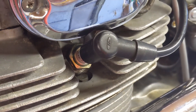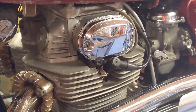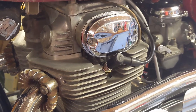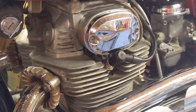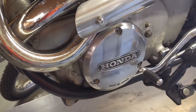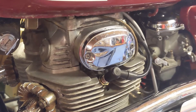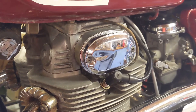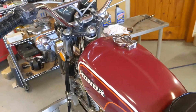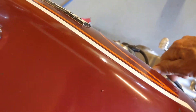Next, tighten the spark plug finger-tight first, then finish with the wrench and rehook your spark plug wire. It doesn't hurt to go ahead and check the oil level again to make sure you haven't lost any noticeable amount — really only about a teaspoonful comes out from the alternator cover, so it's usually not an issue, but it never hurts to check. Now get the lift down and start it up. First, put the fuel cock in the reserve position because there isn't a lot of gas in it.